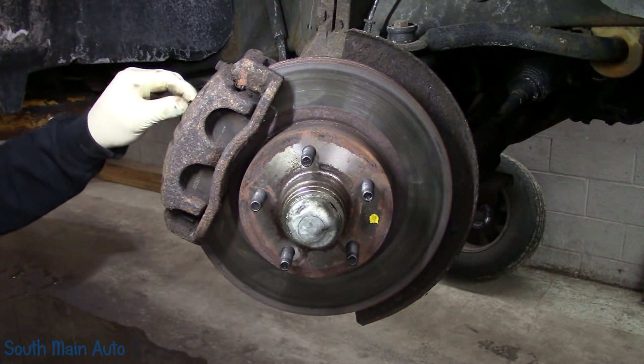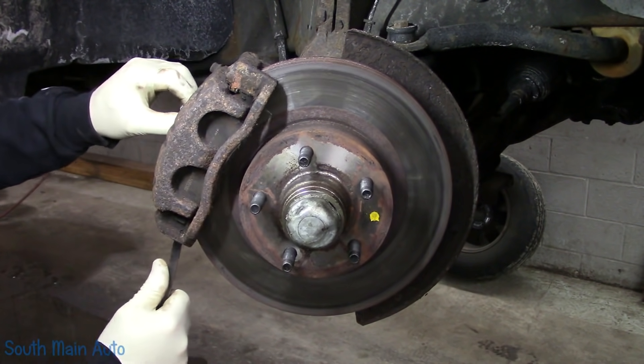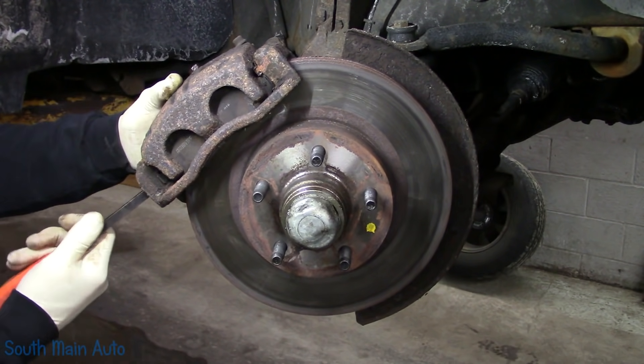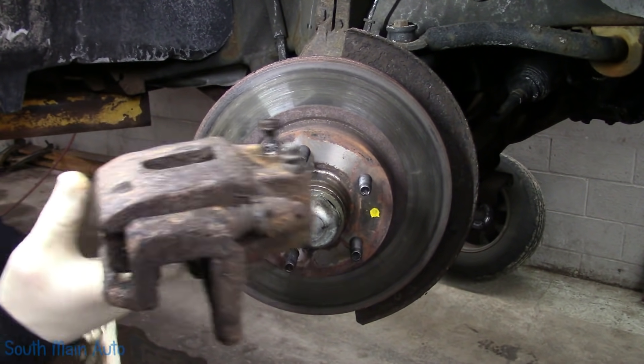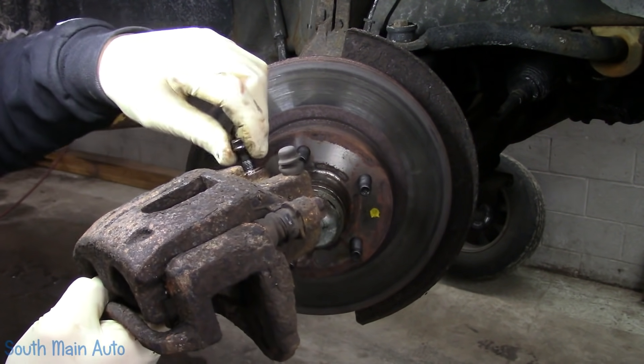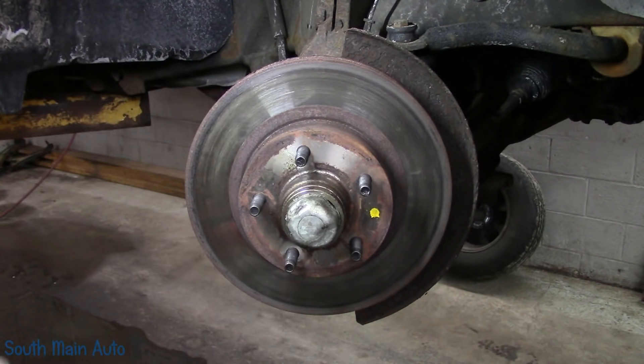The lady - or rather, he told me the back brakes are pretty well shot and the calipers have been hanging up. Once the whole caliper's off, I'm just going to pull the banjo bolt back out and drain it into the bucket, let her drip.